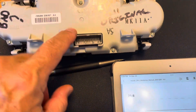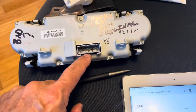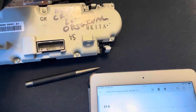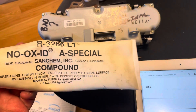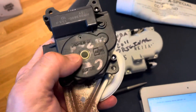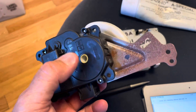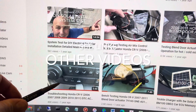If you can get the motor working, disconnect this connector. I have another video showing how to pull this unit out of the car. Here's the part number — I got a new one, but it's possible the connector is just a little corroded. You can use dielectric grease, smear a little on here, and put the connector back in. If you live in a humid environment, that may be your problem. Some people have also found that just banging on this part with a hammer while it's still in the car will actually solve the problem.